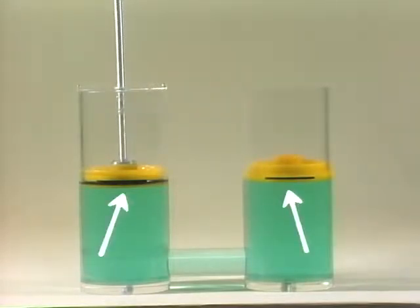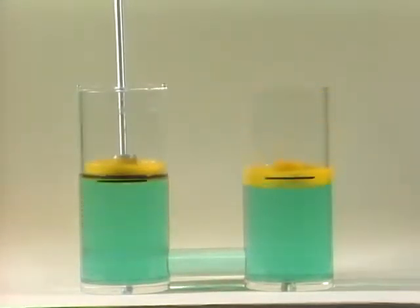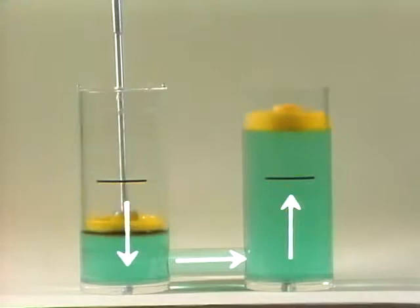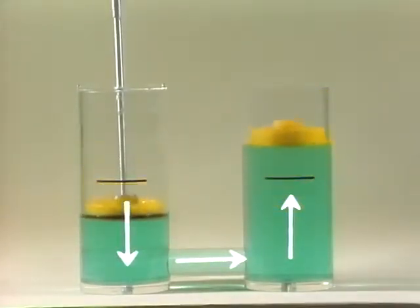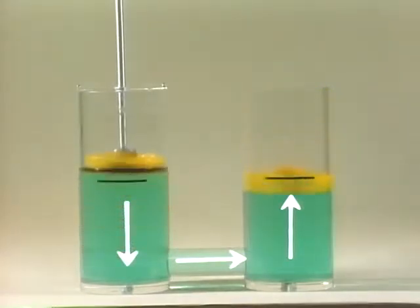This mock-up has a weight in each cylinder — we'll call these pistons, like those you'd find in a hydraulic brake system. Let's watch what happens if we push down on one of the pistons, putting extra force on the liquid. The liquid is non-compressible, so its volume remains the same. The effect is to transfer the force to the second cylinder, where it acts on all surfaces, but only the piston is free to move and so it rises. The area of each piston is the same, so the right-hand piston rises by as much as the left-hand piston is pushed down. That's because the pressure is the same on the face of both pistons.